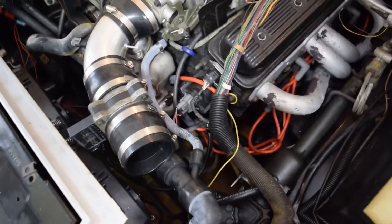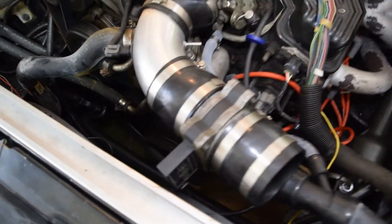If so, there's another trick we can try to figure out where that leak is coming from. You can add some UV ultraviolet dye to the cooling system. If you're going to try this method, go ahead and pick up some UV dye at your local auto parts store, add that to the coolant in the radiator just like we did with the water, and then go ahead and drive your car around for a little while. You want it to get hot, you want the coolant to cycle around the engine, and you want to give it a chance to cycle that dye through and then leak out wherever it is leaking.